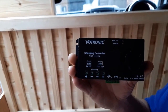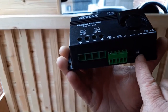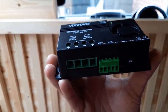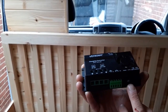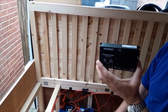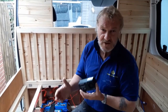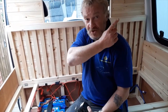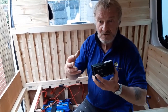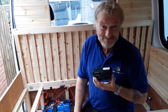That's all you basically need for this to work as a split charge relay on a Sprinter. The extra connections appear to be for lithium batteries. There is a switch with two little DIP switches inside that have to be in a certain position depending on the battery type — with us it's lead-acid, so I need to check up on that to make sure we're happy with the settings. Once confirmed, this can be fitted where the original split charge relay was. So we're covered every which way: we've got a 150W solar panel on the roof, the 240V mains electric with inline battery charger, and the split charge relay — it's all about having all the options to keep your batteries up.